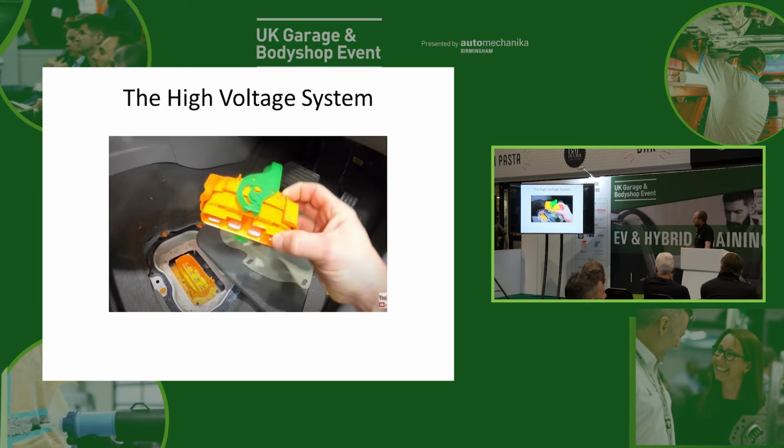So the way to tell if a vehicle has contactors on both terminals or just one is to look at that safety isolator. So if the safety isolator has 4 pins, that is high voltage in, high voltage out, negative, high voltage in, high voltage out, positive, and that means you only have the main relay and the pre-charge relay. You don't have the relay on the other terminal.